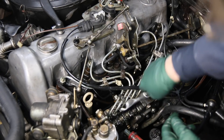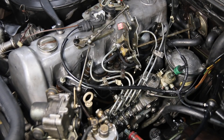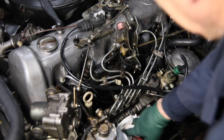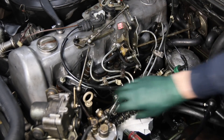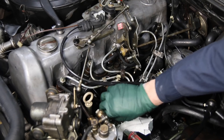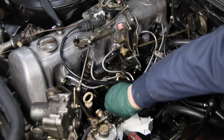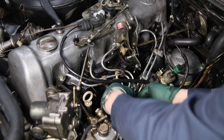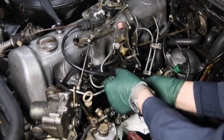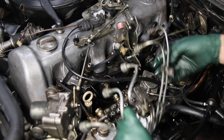You are going to lose a little bit of fuel here, so I'm going to stop right now and put some paper towels right underneath these delivery valves so the fuel won't leak down onto my motor mount. Now I can remove these by hand — just tip it and slide it out underneath the vacuum lines.